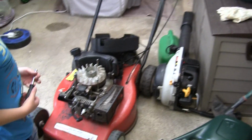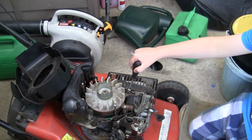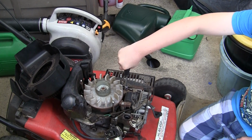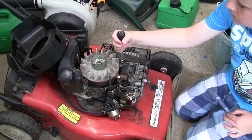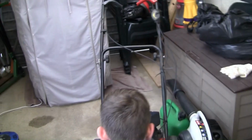I just want to explain a little bit about why I'm doing this really, because most of the problems that come with these little SV150 engines is this carb here and the running problems that you get and the configuration of the springs, just the general way it's done is it's pretty poor really. And the simplicity of this Briggs carb here, basically just bolt it on and it should just work. So that's why I want to do it. I've always been kind of intrigued.